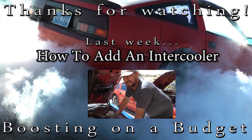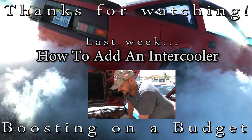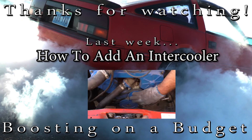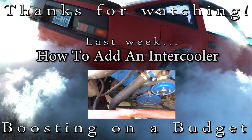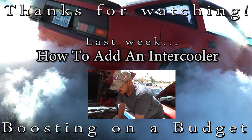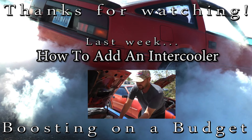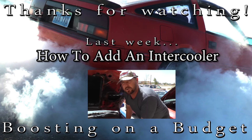There's a lot of stuff I didn't need — like I didn't need air conditioning, didn't need power steering for this car, so my engine is just running the water pump and the alternator with the crank pulley. The air conditioning, air pump, power steering pump, and a bunch of other clutter in this whole area were all removed in this car, which makes a lot more room for an intercooler.